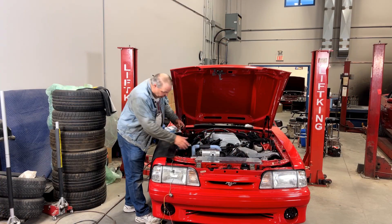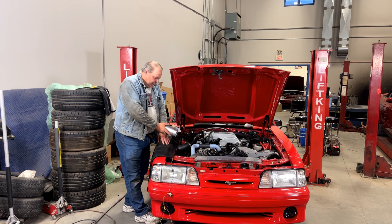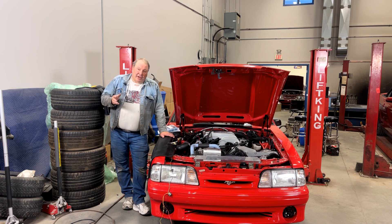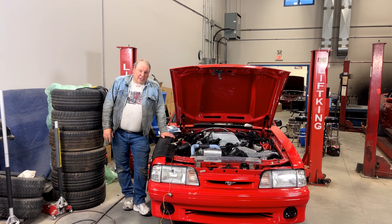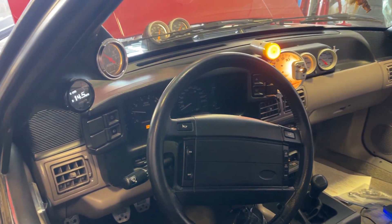Now we've got our new pigtail on the harness, we've got our new MAF, and they plug together. We can stick this back in the inner fender, put all the tubing back together, and see if we've got a car that'll run. Whether you're wiring in a pigtail for an SN95 meter or one of these slot MAFs, the procedure is really the same. The difference is: on the SN95 the two outer wires are for the IAT, on the slot MAF the two upstream wires are for the IAT, and on the slot MAF they're labeled one through six instead of A through F. I'll put a diagram or cross-reference in the description so you've got something visual to look at. It's just that easy — these are electrically compatible, and now we've got a big meter back in the car.